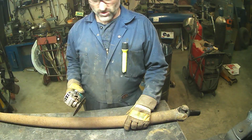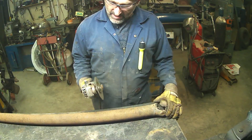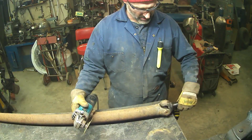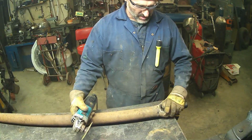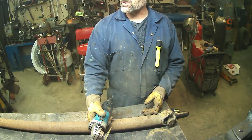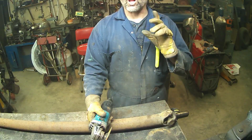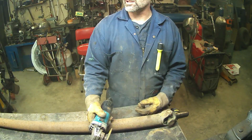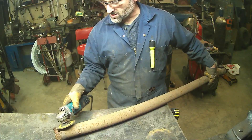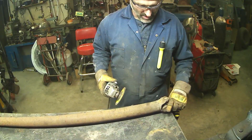I am shortening another drive shaft. I don't know if I showed everything when I did it last time, so I'm going to go through it step by step. This drive shaft has to get shortened like three quarter of an inch. I usually run the zip cut right on the weld and then I can bash the end off — that'll cut my three quarter inch out. I'll do it all on the vehicle, for a guy who doesn't have a lathe, how to spin it and square it up. I'll have to get a U-joint because the drive shaft doesn't have one and I don't have a good one in my stockpile, so I'm just going to get right at it and cut it up.